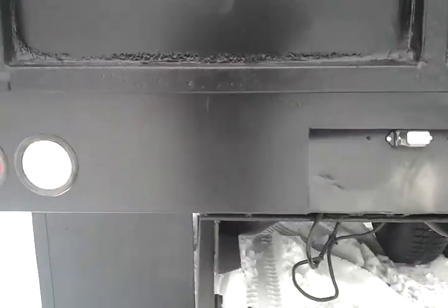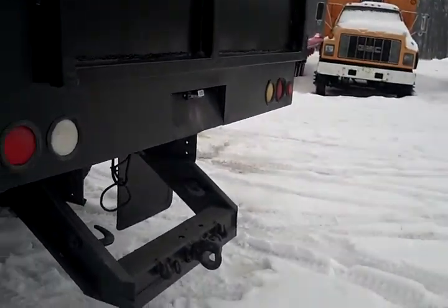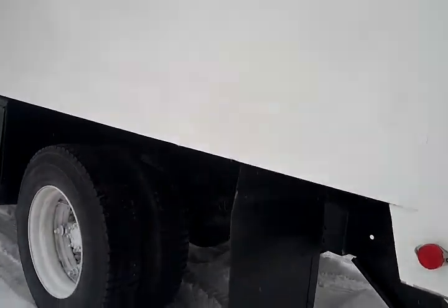Look at the clean frame. This is a heavy duty box, ladies and gentlemen. It's been reinforced, it's been fixed up. We cut this thing down with the sand blaster — we took the paint all the way off to the bare metal. We undercoated it, primed it, repainted it. Now she's standing tall.